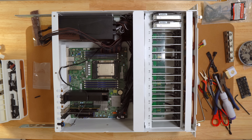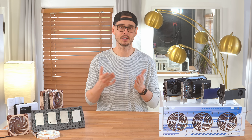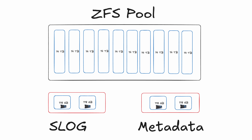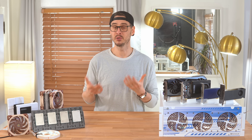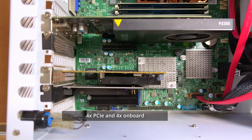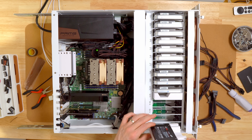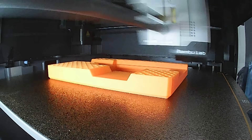The main ZFS pool is still 10 by 14-terabyte drives in mirrored pairs — about 70 terabytes of usable space — but now I've added some SSDs to support more dynamic workloads. I started with four Intel Optane drives: two are mirrored slogs for faster sync writes, and two are used as a special VDEV and metadata VDEV, which helps with small files and speeds up reads from the main pool. Tuning the metadata VDEV took a couple of days because it was all new to me and it probably deserves a video on its own, but the boost in responsiveness was already noticeable. Two of the Optane drives are in an 8x PCIe riser card that supports bifurcation, so each drive gets four lanes. The other two are split between a motherboard slot and another riser. I added heatsinks to all of them just to make sure they stay cool.